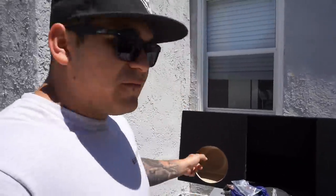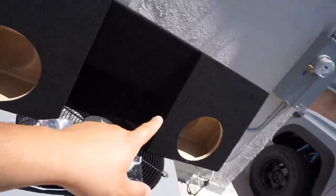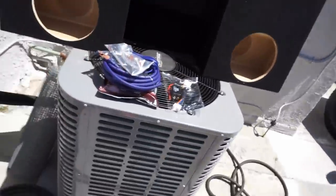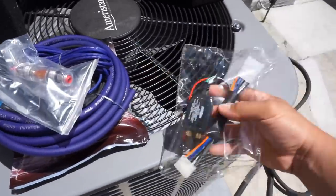They even give you an option for an extended depth of five-sixteenths of an inch, which isn't much but when you're working with a tight space it helps ensure the subwoofer fits. I already tested that these P1s would fit. The P2s would have been a very tight fit and the P3s probably wouldn't have worked at all, so instead of taking the risk I went with the P1s. I figured 600 watts RMS would be plenty, and I'll link the website for these enclosures down below.